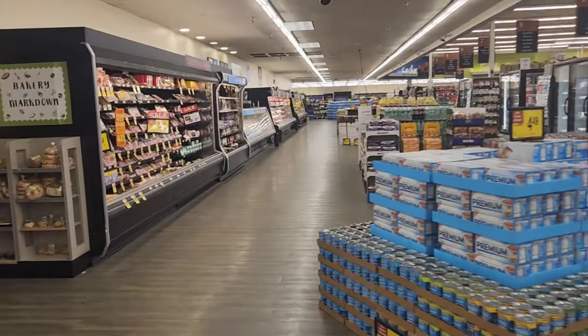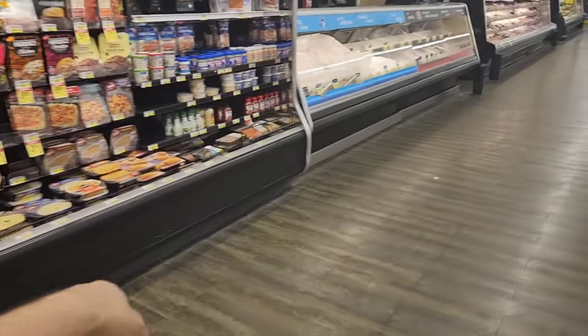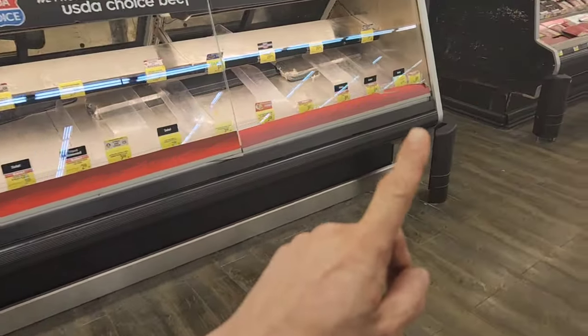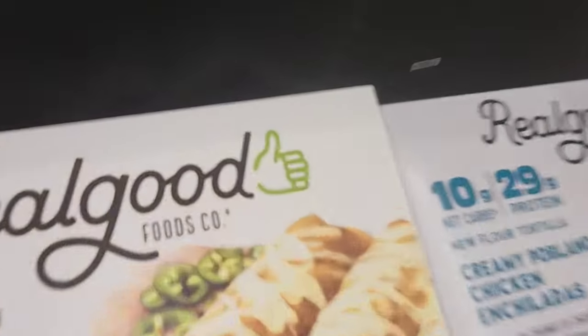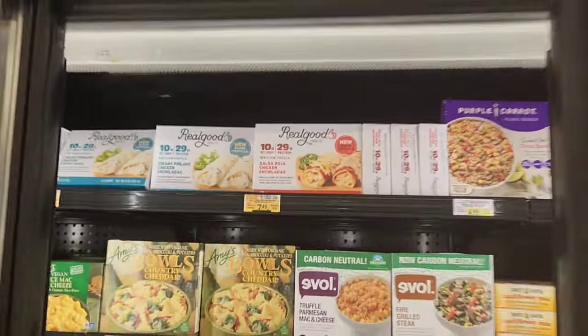Got to get a thermometer. This store is one of my regulars — you can check out the video I did a few months back when I had to rebuild the drain line, wash this nasty thing out, replace the liquid line solenoid valves, redo the drains. I'm going to get my thermometer and verify the temperature on those cases. If you look very closely, you'll see a sticker that says 'L sensor' — that's where your sensor is, in the cavity that the sticker is in.